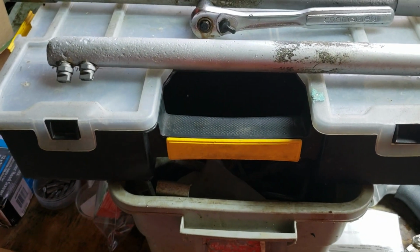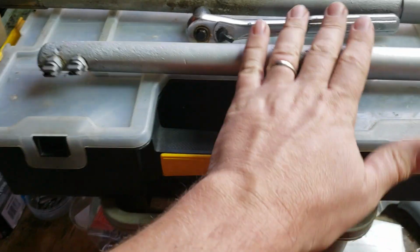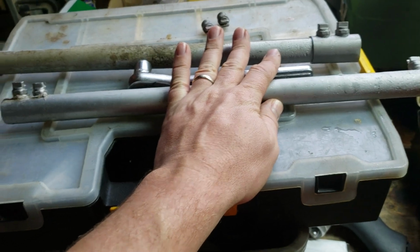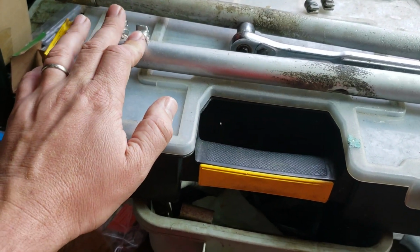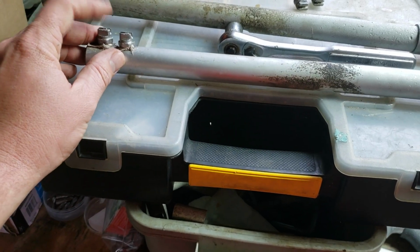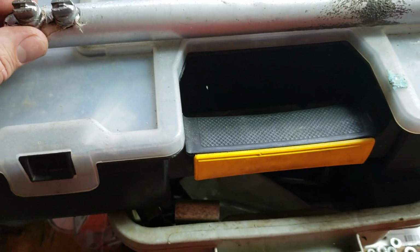If you're having issues with cleaning stripes, it's vibrating, it doesn't seem to be doing right, the first thing you're going to do is flip it over, put your foot on there, and then pull the trigger. And look at it. It'd be really, really obvious. Look, there's two sprays right here. There's one spray here, and then there's nothing. There might be a little bit of water just shooting kind of straight out of there. But this one definitely, it's clogged. We'll take that out, get the debris out of there.